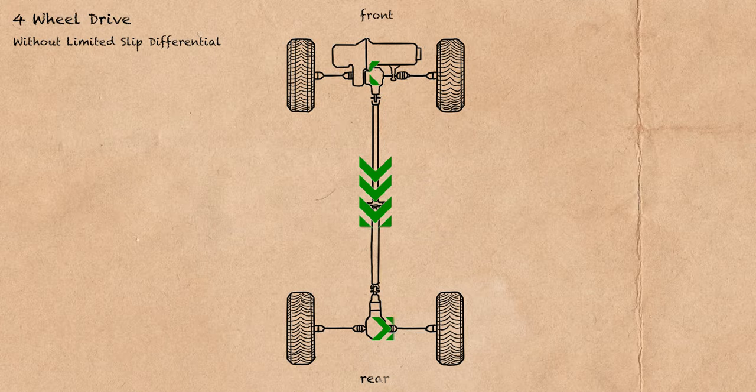They say four-wheel drive, but that is two of the four wheels are driving — one of your front wheels is driving and one of your rear wheels is driving. So there are a lot of conditions where both one of your front wheels and one of your rear wheels have limited traction. They're both on ice or snow or in sand.